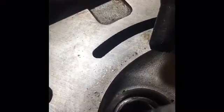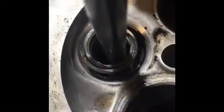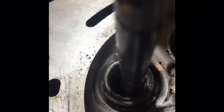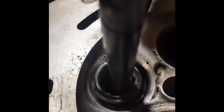For the sake of time, I didn't include the grinding in that time, but I also didn't remove the Sharpie, and if you could see now, that Sharpie was removed from all the other surfaces, so we know that that area that was a low spot is now uniform with the rest of the 30-degree surface. So now we need to figure out what that means for our 45-degree surface.